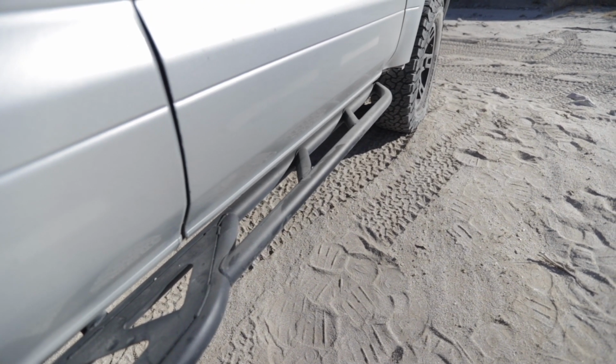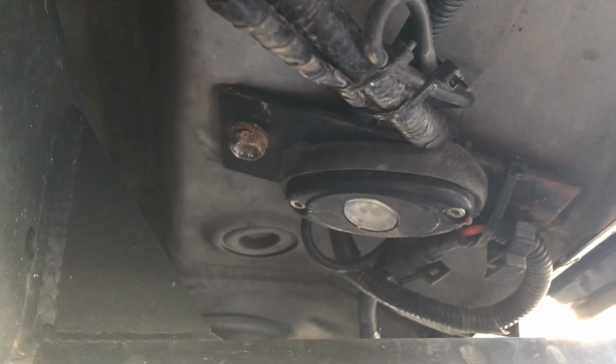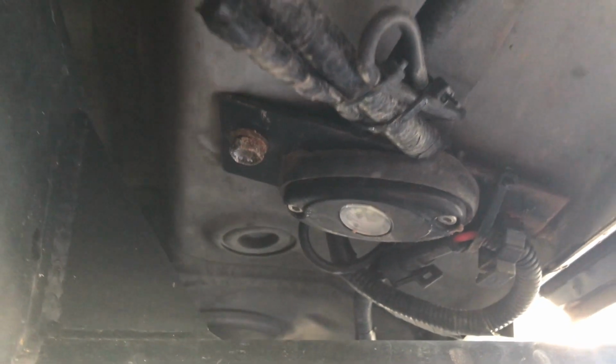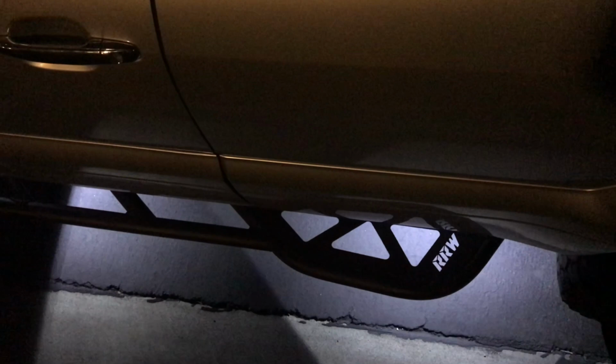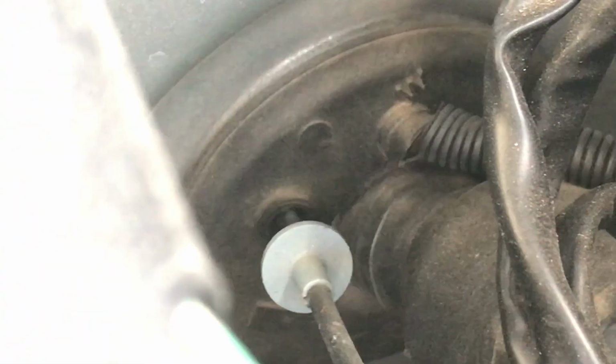I wanted to relocate the light to point straight down, so I modified the factory wiring harness to accommodate the LED lights, fabricated a couple of brackets, and mounted them in the previous running board mounting locations under the front and rear doors. Since using these inexpensive LEDs for the courtesy lights, I decided to add rock lights into the wheel wells. The problem was, do I make another switch point and keep running wires through the firewall, or consider getting an accessory switch panel to control them and future lights and accessories?